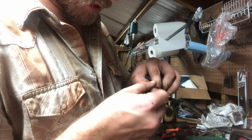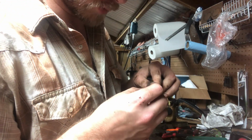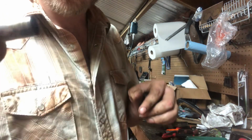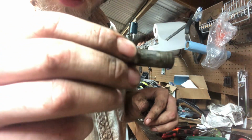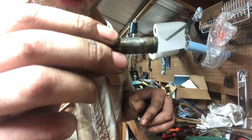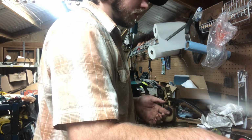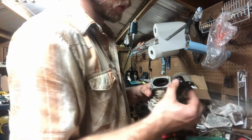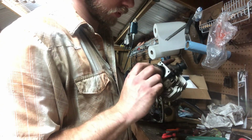It appears that the wrist pin seized. Evident. I don't know if y'all see that. See the markings on it where it seized. I believe that was most of the issue, along with, I think this piston is real tight in this bore.